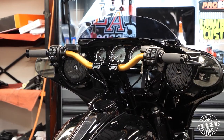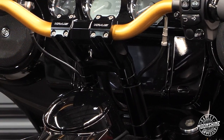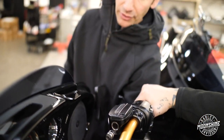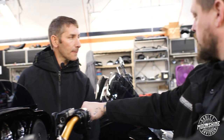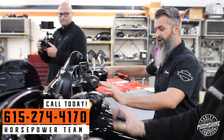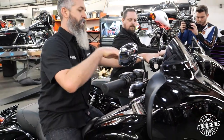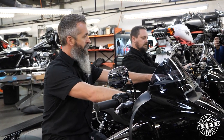That setup has a 10-inch kickback riser with a T-Rex pullback plate. The T-Rex pullback plate on this bike allows us to run risers with a batwing fairing — either a straight riser or a kickback riser. Comparing that bike to this one, the handlebars are pretty much similar in height on both bikes. On this one the riser is lower, so if I'm using this bike I have nothing impeding my hand movement to my radio, my navigation — it's a little easier.